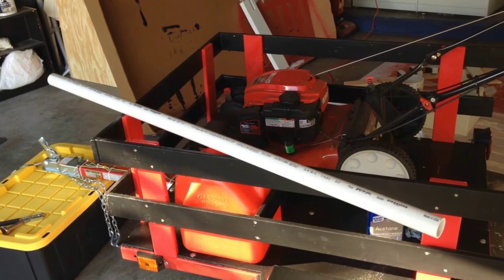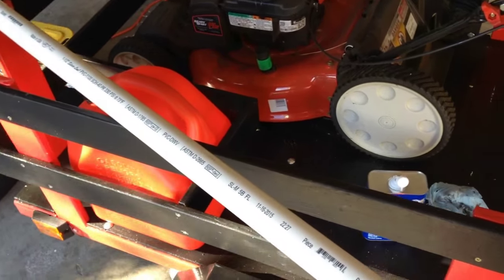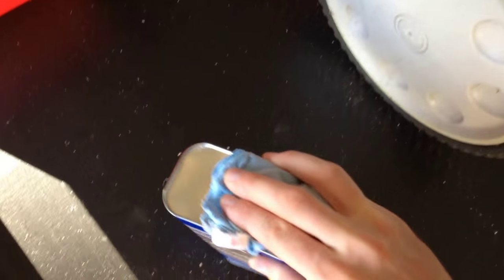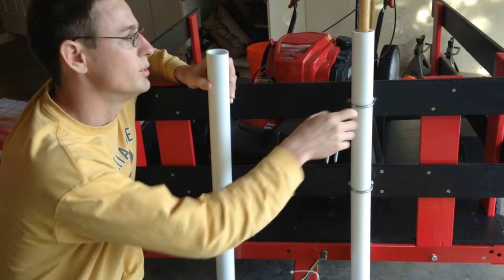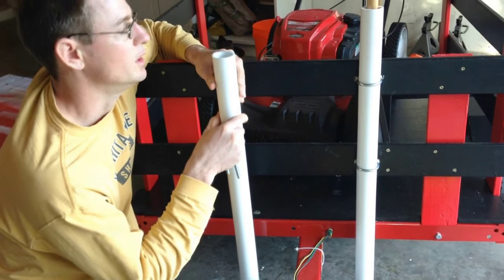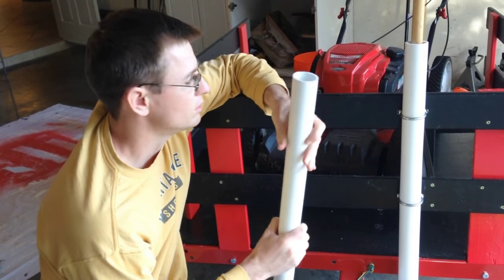I bought a five-foot long piece of PVC pipe, one and a half inch diameter. I'm going to cut it in half and mount the two halves to the front of the trailer to make holders for rakes and stuff. It has a lot of printing on it which is annoying — so just take some acetone on a rag and rub it hard and it comes right off. For the U-bolts, I'm using a one and a half inch wide U-bolt from Home Depot for about a buck fifty, but the PVC is one and a half inches on the inside so it doesn't fit around. I'll show you what you need to do to fix that.